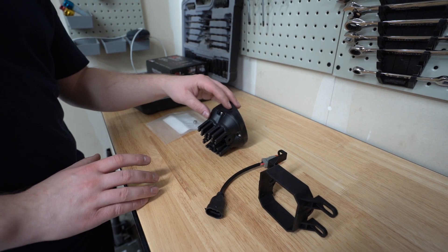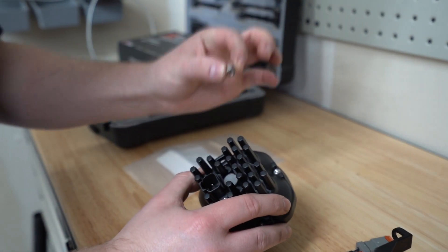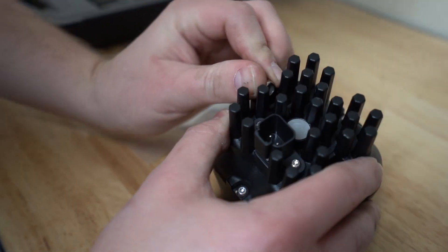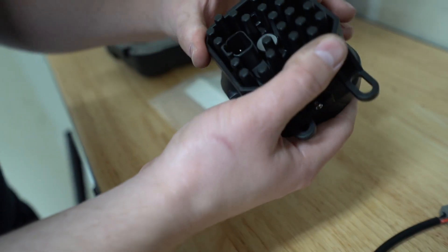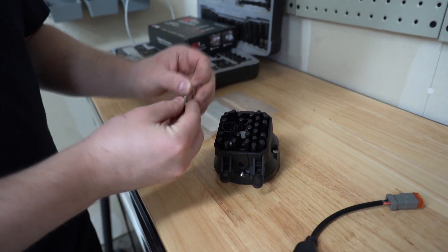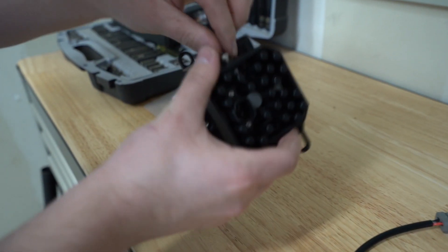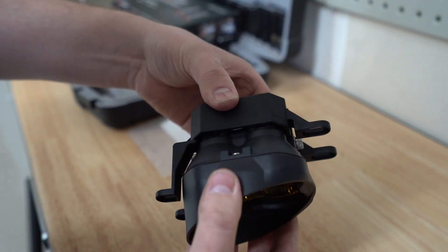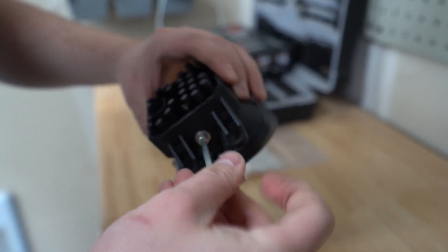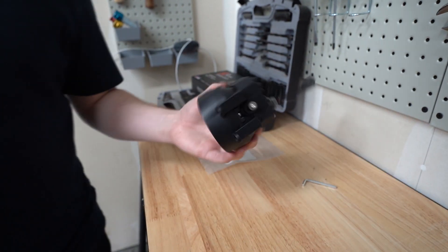Super important — the orientation for the Tacoma. Each side is different, so you want to make sure the plug is on the bottom. Take the hardware and slide a bolt into each of these little spots. Then take the bracket and put it over the back like that. Once that's installed, take the screw and the washer and put one in on each side — it's going to thread into that little bolt we just put in. Same thing on the other side. Now this can be adjusted, so you might want to test fit it first. You'll tighten the sides with just an Allen key. Then plug in the harness — it clicks — and we're ready to install this back into the Tacoma.